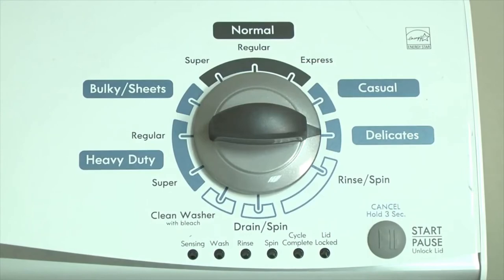All the green status lights blink when you successfully activate the diagnostic mode. If the status lights don't blink, turn the control dial one complete rotation counterclockwise to reset the control and then try again, this time turning the knob faster.